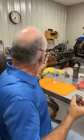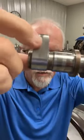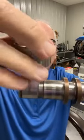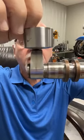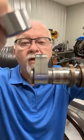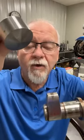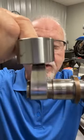So I got a cam here. This is one of the cams he made me. And if you look, you can see the wear, where it made a stripe down the center of the lobe. So the point contact on this was the most brutal thing we had ever seen. You're talking about learning what your oil's good for? Back in the day, man, we thought about rod bearings and pistons and wrist pins. But I'm telling you what, this right here will test your oil.